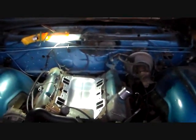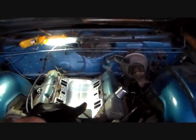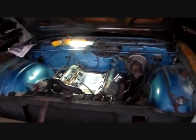Also, don't forget when you put this intake on that the negative battery cable goes under that bolt right there. So you put the intake on, then you put the cable, and then the bolt through it — not before.